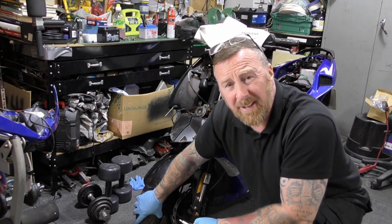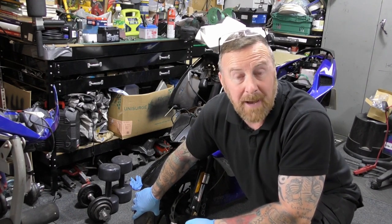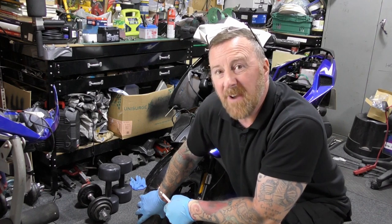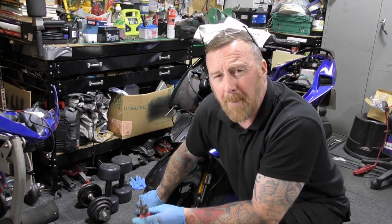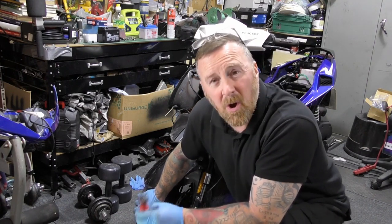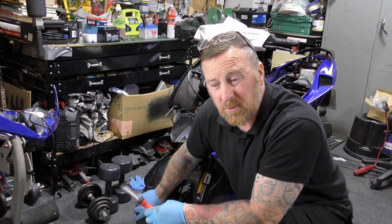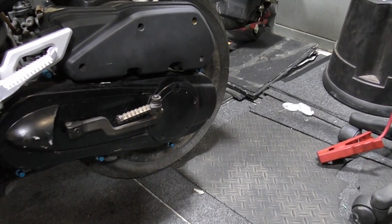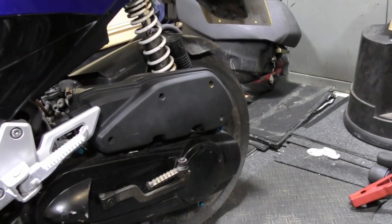Tyres are good tread on here. It does start, which is lovely to see - revs up, new plug. I'm debating whether to check the carburettor out and clean it, and also debating to take the variator cover off and look at the rollers, but what I'm going to do is fit it all up, test ride it - ain't broke, don't fix it. From years of experience I'll know when I jump on this. It's got a nice sports exhaust on this one. The front end is off, however the rear panels don't look too bad. Looks like someone's brought some little blue bolts for the actual engine cover, so that means someone's actually taking a bit of care of it. Still the basics - you've still got your old plug at the front, but you've got a CDI and all the other bits at the back, and the two fuses.